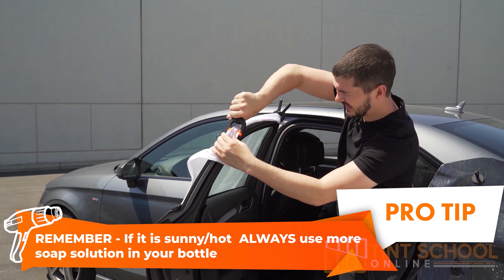So here I'm holding the film — you do not want to do outside tints with the no-touch method. Notice I'm pulling this away; the reason is because when the wind tries to pick up any of the film, I've got a good grip that's going to stop it from touching. I'll come in here, still holding this side, and I can feed the film in. Give it a spray — everything at this stage is all as normal.